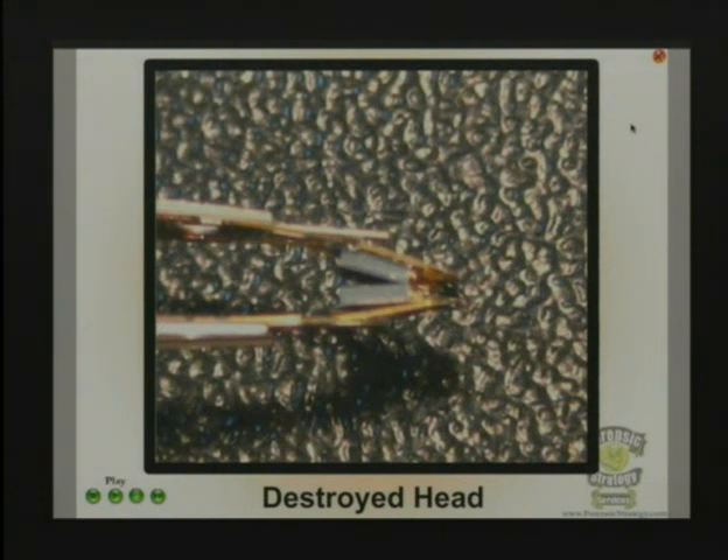This is what it looks like when it's bad news. If your piece of paper falls out — and this is important — you need to be in a spot where nobody's bumping your arm. Make sure there's nobody standing behind you. Just lock the door or whatever. Make sure that the components do not hit each other at all, because if your arm gets bumped and that little piece of paper falls out, it's game over. You're not going to be able to do it. Just stop right there, close it back up, and go back to eBay. Get another drive. Start all over again.